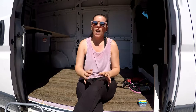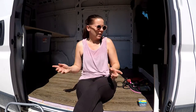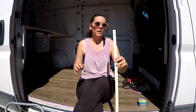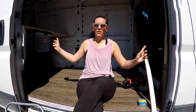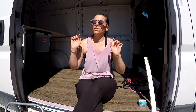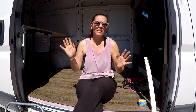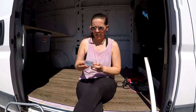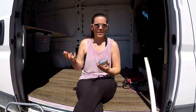Hello friends, I'm getting ready to start the next step, which is insulation, but there are a couple things I want to do prior to that. I want to put a couple of nailing strips along the van using these one-by-two inch strips of wood, to later attach the interior siding and some shelves. This will be the first time I'm doing any drilling into the van. I wasn't sure what kind of screws to get, so I went with these self-drilling Phillips screws that are inch and a half — we'll see how this goes.